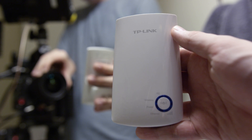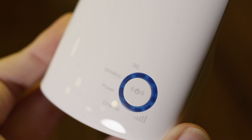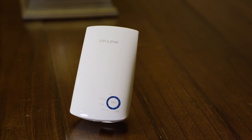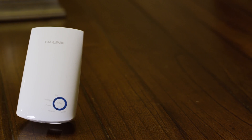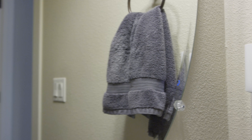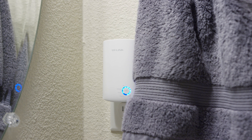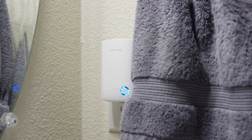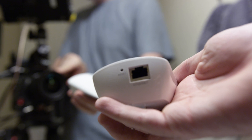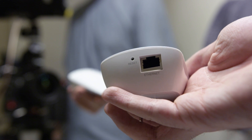So should you really go out and only spend $20 on a Wi-Fi range extender? No, this does not give you the best possible performance. It says 300 megabits per second, but it's not delivering that, and I should be getting at least a $50 device, if not more, to be happy with this. It does lack a couple of features — if you're looking for higher performance, I would recommend getting one that has 802.11ac with 5GHz. This one is only N, so it maxes out at a lower speed. The Ethernet port on this is also fast Ethernet, meaning it goes up to 100 megabits per second, which is fine for internet, but if you want to do data transfer to a server on your local network, this is not going to be a good option — you're going to want something with gigabit speeds.